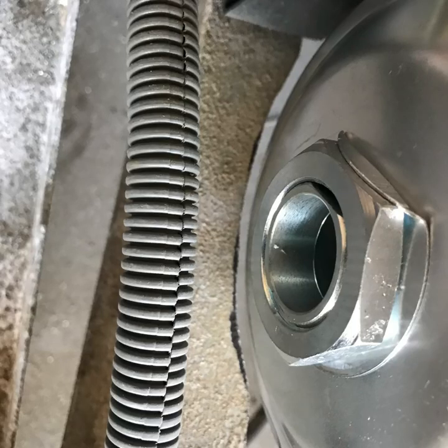After I got my motor mounted in, I noticed I had to grind the frame a little bit to fit the clutch, because the clutch would hit the frame. You can see it cut out right here and it's barely touching, so I'm going to have to grind that just a little bit more to make it clear so the motor will sit flat and level.